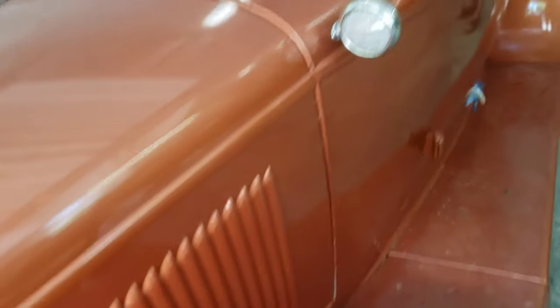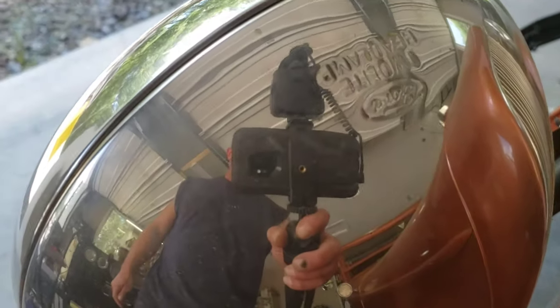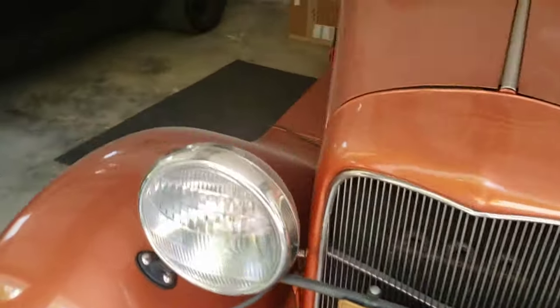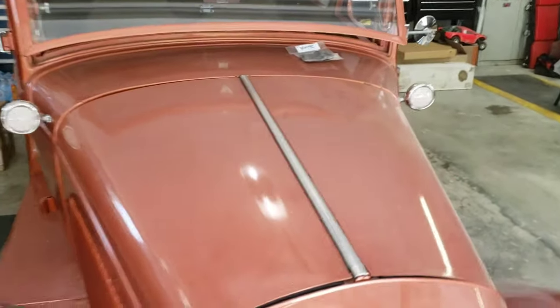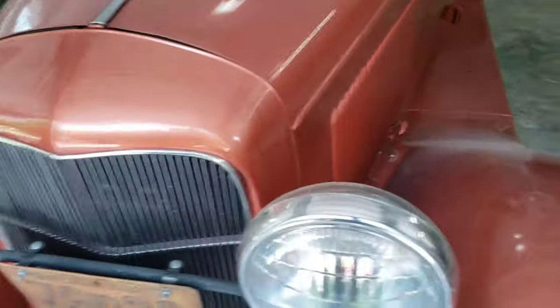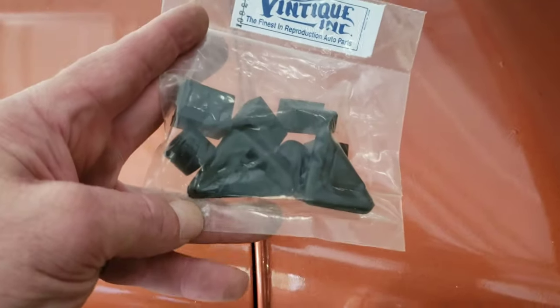The drivetrain is a small block Chevy. It's a 350 Chevy, 30 overbore, tunnel ram, small comp cam, two Holley 450 carbs. It's got a Turbo Hydramatic 400 for a trans, about a 2800 stall converter. We have a Ford 9-inch, four links and coilovers for the rear. The front suspension is a dropped I-beam with the original style buggy spring.